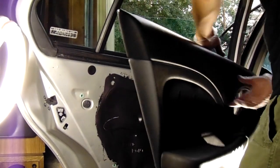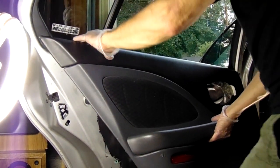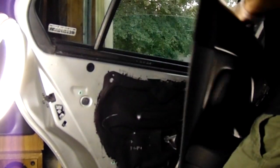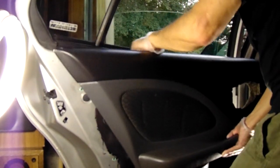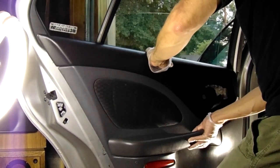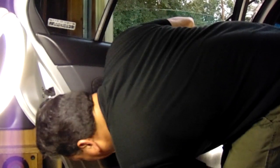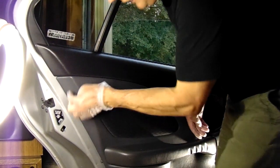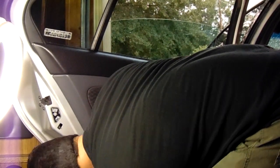There's a small panel around the door handle — it may be easier to put the door panel back on if you remove that first. Now align the thin metal lip at the top of the door panel and slide it down into the ridge along the top of the door. Once you get it in there, tap it down and it should lock in. You may have to try that a couple of times before it clicks in. Then align all of the green tabs and click them in one by one to secure the door panel back to the door frame.